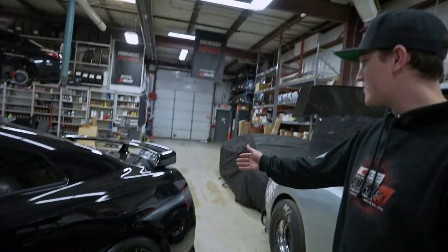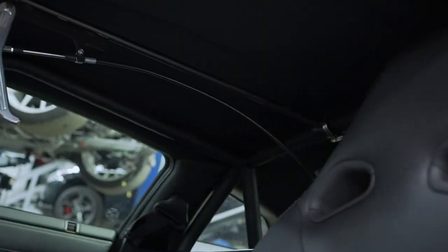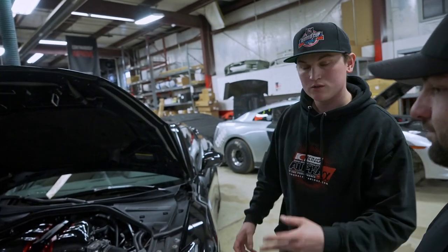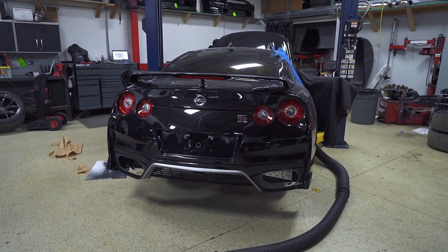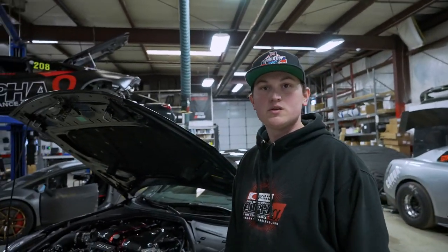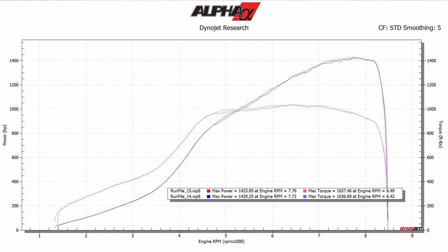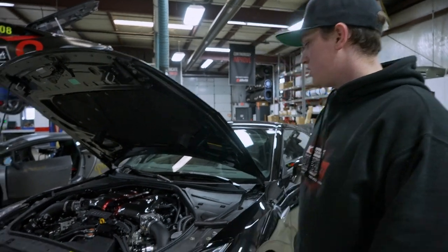It's looking really good. We have the chute mounts done. We do have a removable chute handle. Everything went really smooth — went ahead and did our oil change and all the normal stuff. The car made really, really good power. We're limited by injector right now, which is fine. The Heralds need to get a little bit of seat time in the cars before we turn them up and see what they can really do. It made about mid-1400s — just under 1,500 horsepower on the 18X kit. We've got a little bit of room to grow. Nothing to sneeze at.